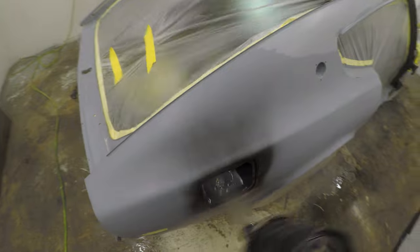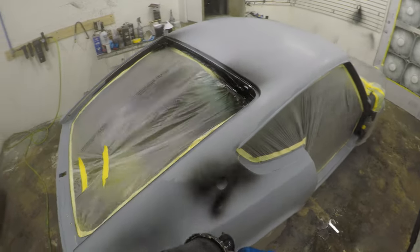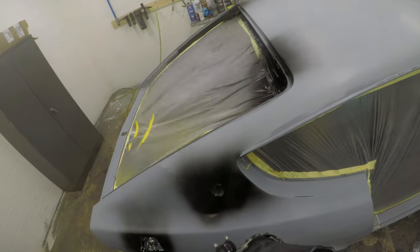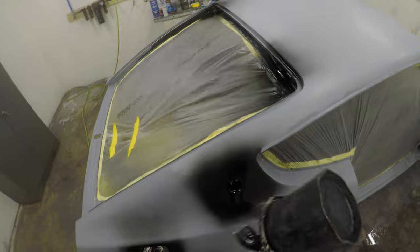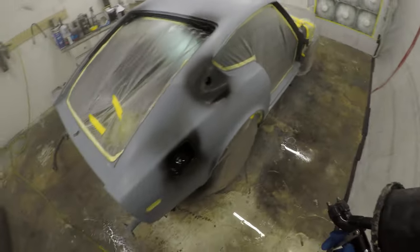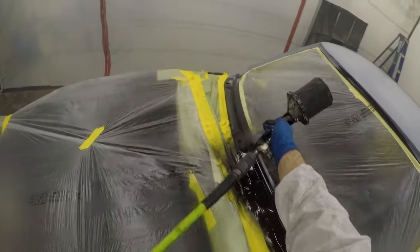And that's the reason we're doing the sealer today, to provide one last opportunity to fix all of those little poke throughs of little bitty small parts of filler that came through during the wet sanding process. Give it one final good coat, and that's all that's required for a sealer, is just one coat.